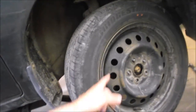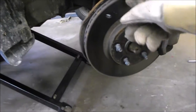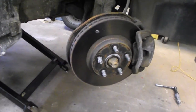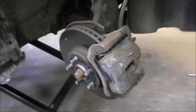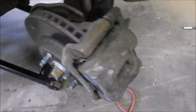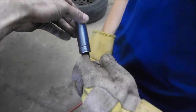Next we'll take the wheel off the car and slide it out of the way so no one trips on it. Now we're looking at the disc and the caliper. We need to remove the caliper so that we can get the disc off. To do that, we'll put the ignition in the on position so that we can turn the steering wheel. Now we have the caliper facing out and it's easier to work on. To remove the caliper we have two 17mm bolts — one on the top, one on the bottom — but we don't have to remove the slide pin bolts. We're going to use a 17mm socket on an impact wrench.